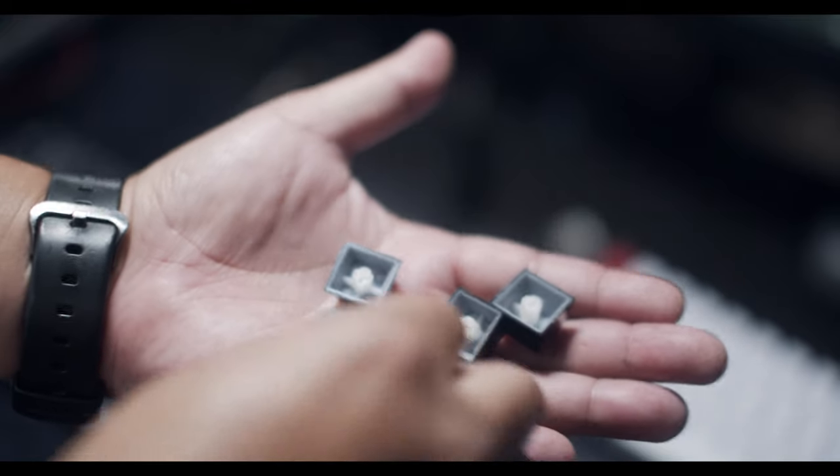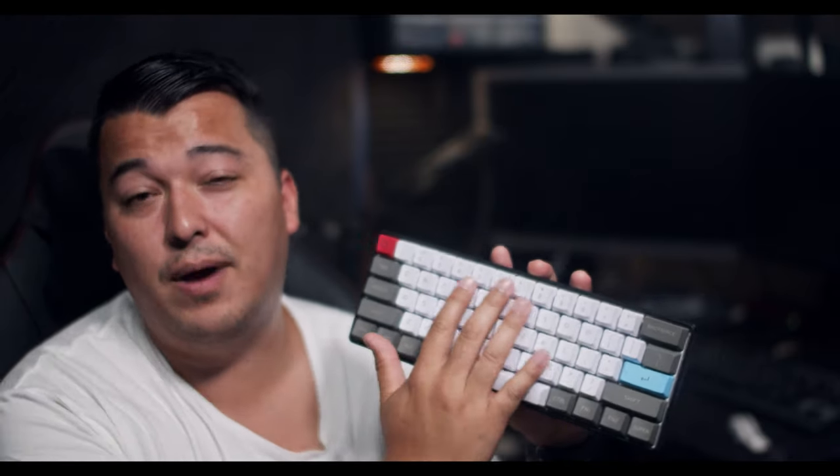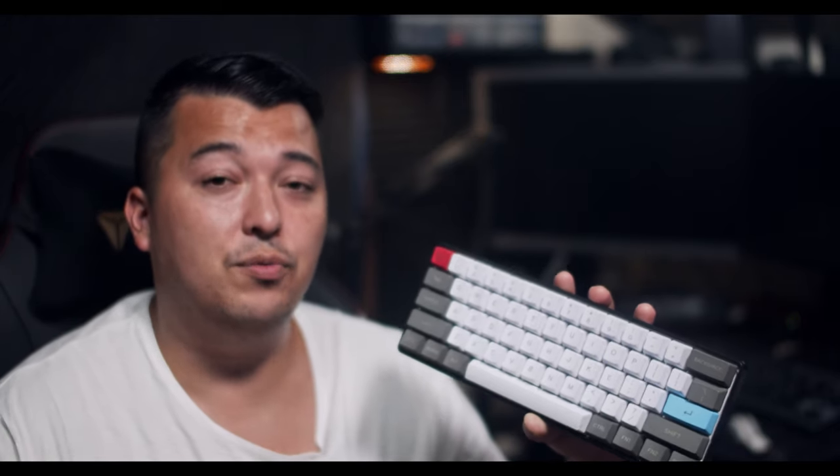The keycaps on this one are not the same as what you would receive in the box — I swapped them because I felt they add more customizability and aesthetic. You can leave the stock keycaps or find keycaps in the Cherry profile and upgrade it yourself. Initially I bought this with Gateron Blues just to try them, but I later found I preferred linears more, so I ordered Gateron Blacks and lubricated them myself. Even though these are cheap Gateron optical switches, they have their own unique sound and tone and it is very pleasing to type on this keyboard.